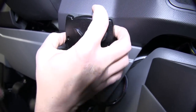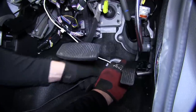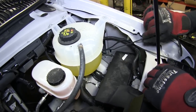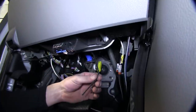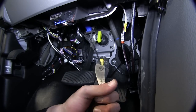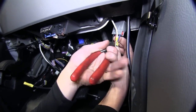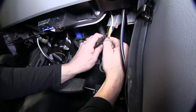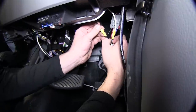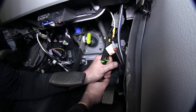For this application, the power lead to the brake controller is also not hooked up, so we'll need to run a power wire to the battery. Taking a piece of the leftover black wire from our gray duplex cable, we can feed some into the engine compartment, cut off any excess, then strip back one end, add a yellow butt connector, and then cut the black wire again on the brake controller pigtail side. Strip back the end and secure it to the yellow butt connector. Now for this application, we've run the leads for the power for the brake controller and the trailer brake power coming back out of the brake controller to our 7-pole and then to our trailer.